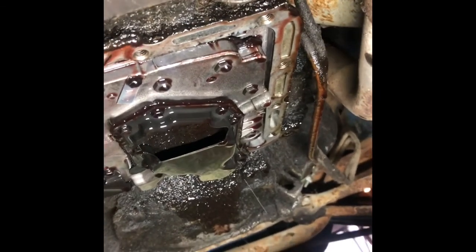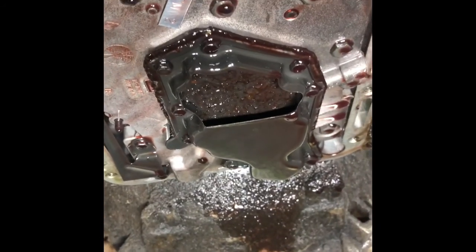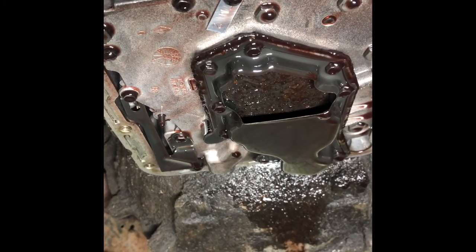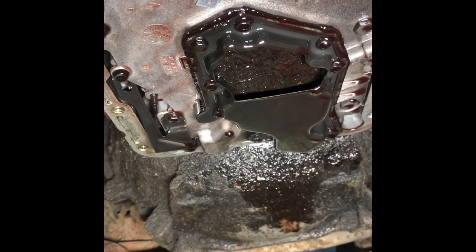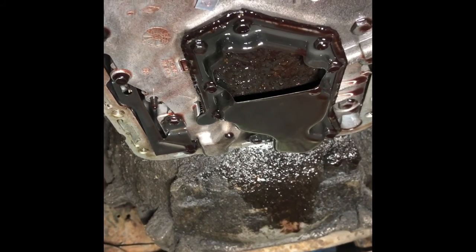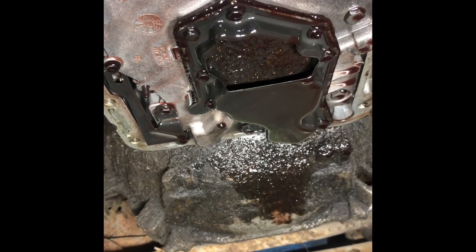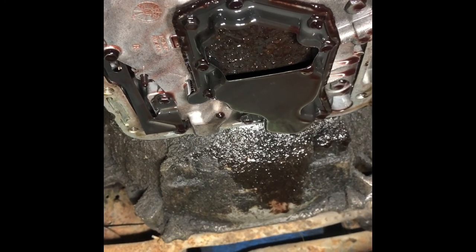Underneath the car, transmission pan down, and I think our problem is going to be that filter. I believe it's plugged up and she's just not sucking up fluid. Did some quick research online and a guy had the same problem and it turned out being the filter. Otherwise I can't really see what would cause it to lose all gears. I know it's common for C4s to lose forward gears, but to lose reverse all at the same time and then let it sit and then it gains it back for a second, I feel like that has to do with a clogged filter that's barely getting any.